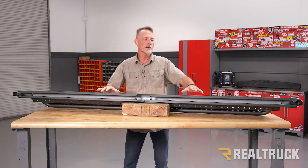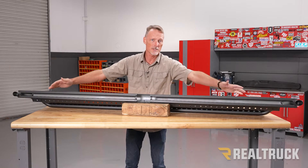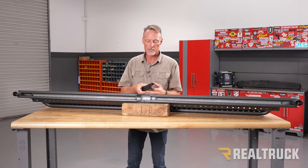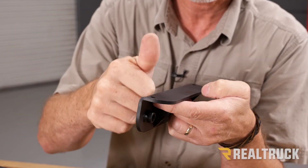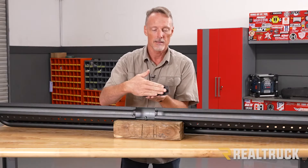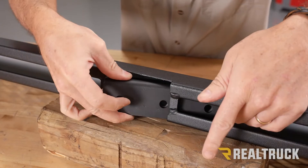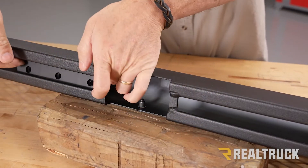This is your D1 step — this is the back side of the board. You're going to notice a large open channel that runs the entire length of the board. The way the board attaches to the brackets is with these nut plates. These are welded nut plates — you've got a shelf on the top that goes to the top side of the board, and the nuts are on the back side, which faces the brackets. We're going to slip two of these nut plates to the front side and one to the back side through this open channel.